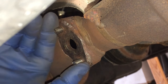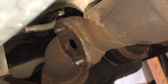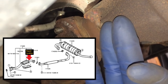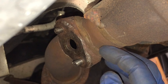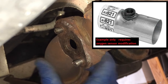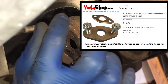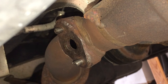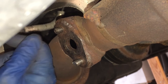There are a few different repair options. My goal is to try to remove and replace these studs — that would be ideal. I don't want to replace the whole stretch because there's a catalytic converter right here and nothing's wrong with it. It would be very difficult, if not impossible, to obtain an OEM one, and then you deal with aftermarket consequences. The next option would be cutting here and coming back with a replacement section, or you can get a repair flange that has studs on it — those require welding. What I'm hoping to accomplish is stud extraction because that would be the cheapest, easiest, fastest, and most DIY friendly.